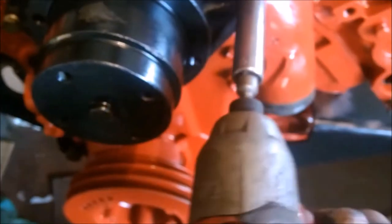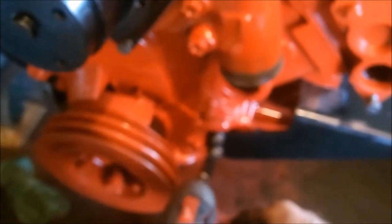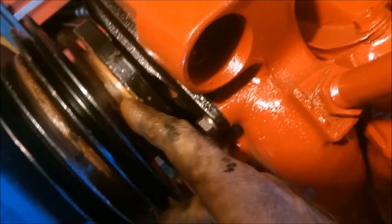Know your tools — this isn't the thing to practice on. If you're using ones from the four-cylinder or other Scout engine, make sure they're the right size and depth. Don't forget to chase all these holes out again after you've got paint on them. Sand every surface that mates and paint them with the anti-seize — that will keep them from rusting and seizing.